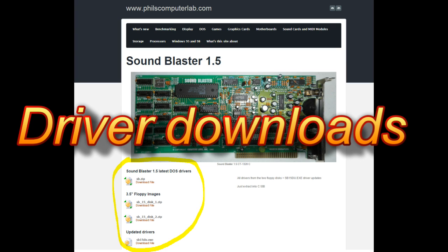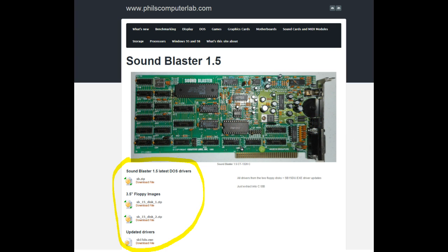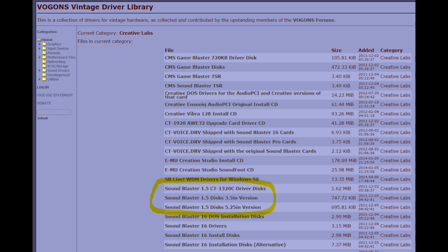All the drivers for the Sound Blaster 1.5 you can download from my website. I put together a zip package which has all the drivers and the updates ready to go. You just need to unpack it into the C/SB folder. Alternatively, if you're interested in installing from the original floppy disks, I've also uploaded 2 floppy images which will create the 2 floppy disks. Another option is heading to the Vogon's driver archive. I'll put the link in the description. You can also get the disk images from there.